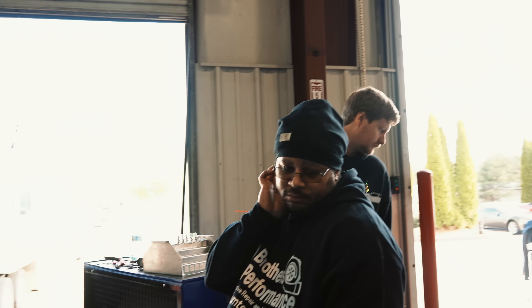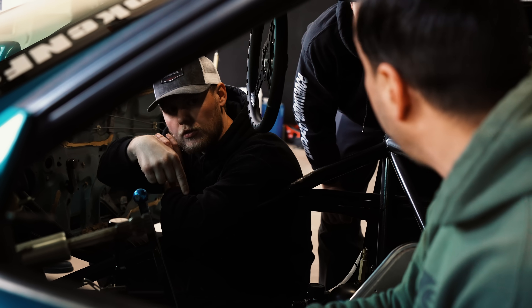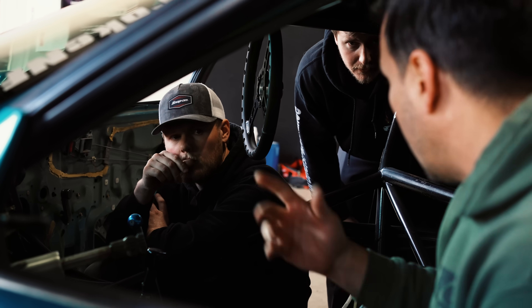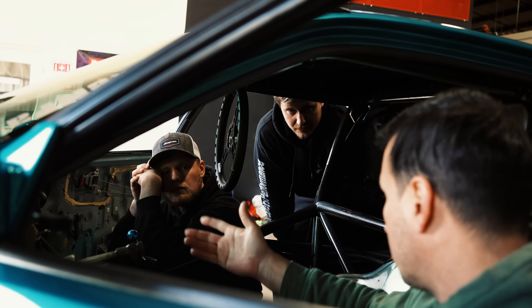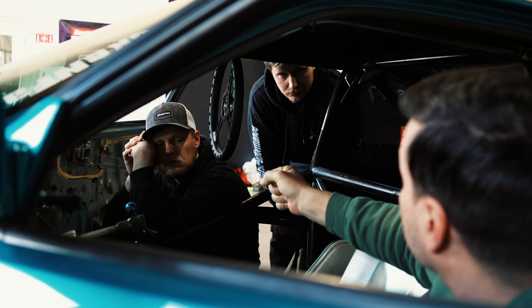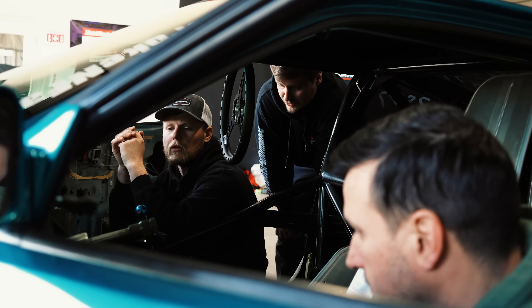We've never driven a strain gauge car, so we don't know what settings to use. I'd put a minimum TPS just in case. The thing is, you can hold it in first gear because it's going to 5V, and the ECU is waiting for 1.5 before it pulls. So you can pull it, go to second, and hold it, because after that cut the ECU is waiting on the other direction. That logic prevents that issue. We were under the impression that people with strain gauge touch it once and never touch it again — they're so scared. In the early stages our system was like that, but we added logic to say: once you did the cut in that direction, don't look for it anymore — look in the other direction — so you can hold the gear if you want. So you can continue to drive how you used to drive.